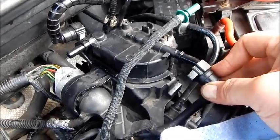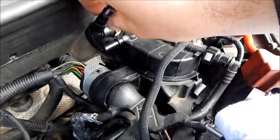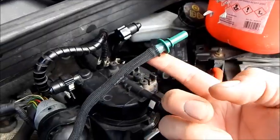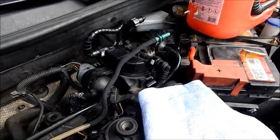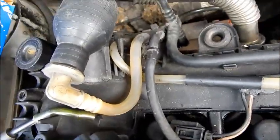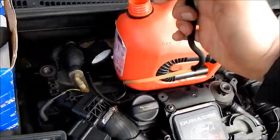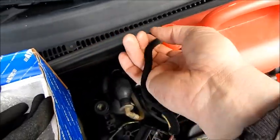We then connect the fuel inlet and outlet lines. As we can see, there is air in the lines, which we are now removing by venting. For this, we take the fuel line from the fuel tank which leads to the diesel filter into the hand, and put the line into the canister filled with fresh diesel, so deep that the line can suck the fuel.